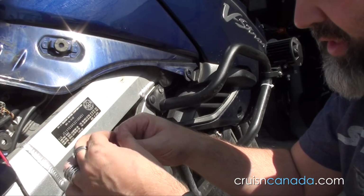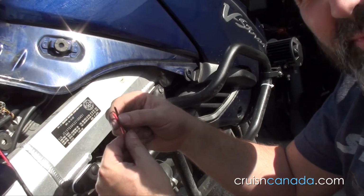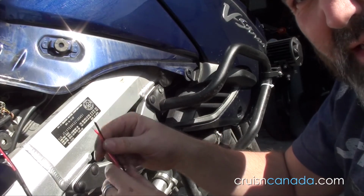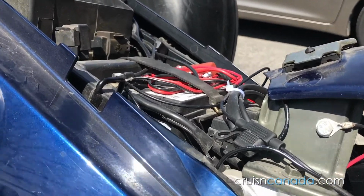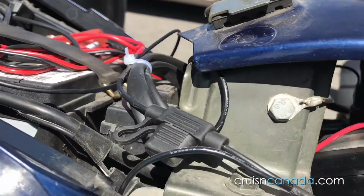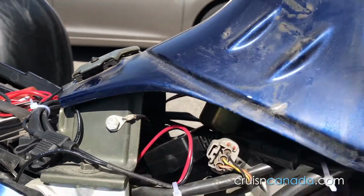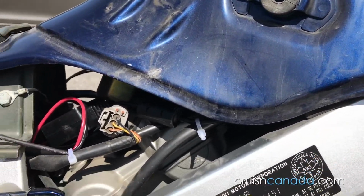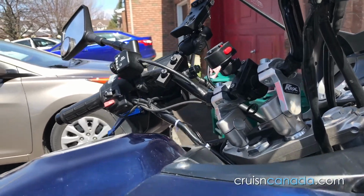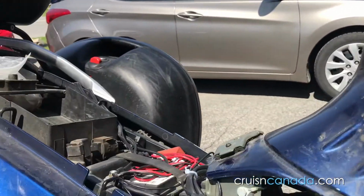Now I'm gonna go see if I have any little clamps that I can get this to fit on the battery. If not, I'm gonna have to strip some of this and just put it on the terminal. So either way, we'll get this going and we'll see how it turns out. Just give me 2 more seconds, guys. Okay, so we got the cables connected to the battery. I mean, we got some twist ties on them so that they're not going anywhere. So the cables are in there nice and good. We're just going to put everything back on so this seals up. Just make sure there's a bit more cable management just up here so that there's no cables going to get in the way, and make sure that the handlebars can move freely without being twisted, and we'll see if it works.